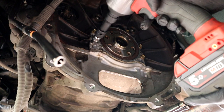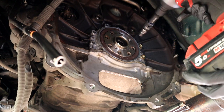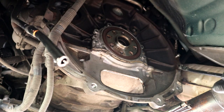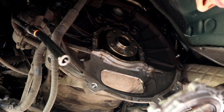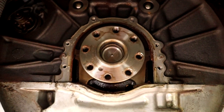I'm trying to get this done relatively quickly because it's going to rain again. Let's get these 10 millimeter bolts out. They're pretty loose — easy to get out. Now I'm going to get a pry bar in somewhere and try to loosen it off. There is a little indent here where you can put the pry bar in. There we go — pull that off. The seal actually looks really good; I don't know if it's been changed before, but I'm going to replace it anyway.